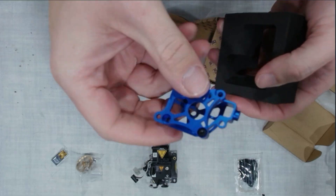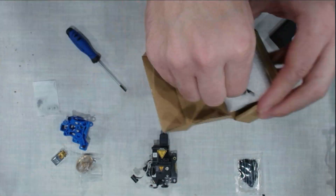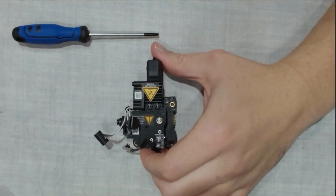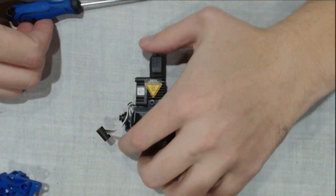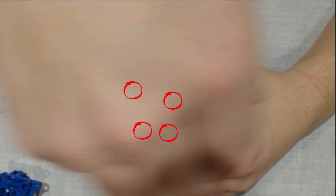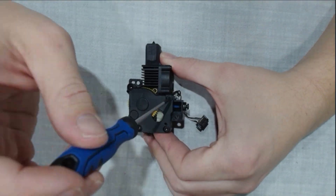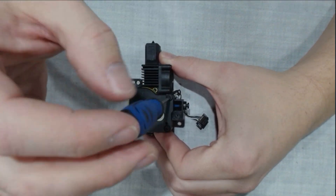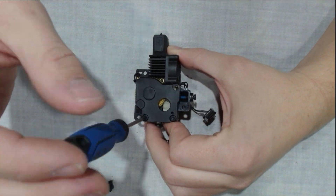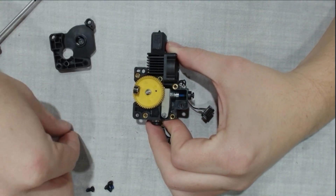The Panda Claw prevents long-term gear wear. The Panda Extruder lets us blow out dust, meaning fewer jams and less failed prints. Now we're breaking down the extruder assembly. We'll go step by step with timestamps in case you need to rewind. First, start by removing these four screws. The Panda Claw is hardened steel, so it wears down far less over time. And the open frame Panda Extruder gives you better access for troubleshooting and cleanouts. Now you can see our culprit — some of these plastic gear teeth look like they've missed a few dentist appointments.